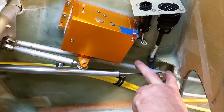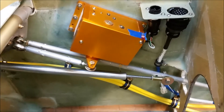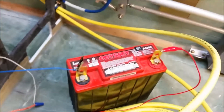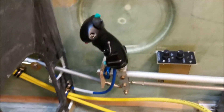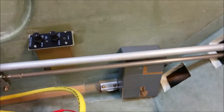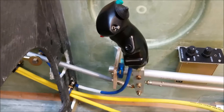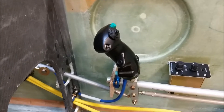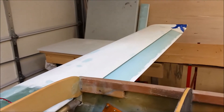I'll have to contend with this part of the elevator control tube to get that patched up. I've run the power wire to my battery right here — the PC680. Here's the control stick. I've gone ahead and left this box in here because otherwise the control stick wants to flop over since I don't have any aileron pressure on it right now. It leans about five degrees and that infinity stick is kind of heavy, so it just flops over to the left. I have my switch here and I'm going to show you the actual pitch trim and how it's working.